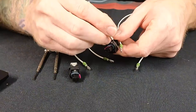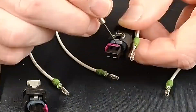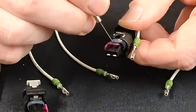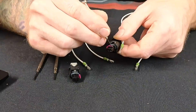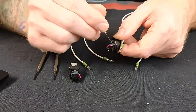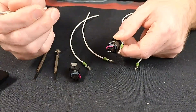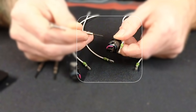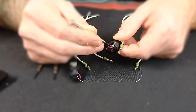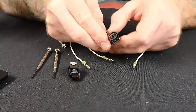On these, sometimes they'll get caught in that channel just right where the purple piece is. So on other style connectors these aren't bad, but sometimes it gets caught. So you may have to press it down in the open hole that's made for it. I push that catch down, get it to slide back, pull the screwdriver away, but there's another opening and the spring will pop back up and get caught there. So sometimes you've got to push that down again. But that's it on L64A2 to remove the wires.